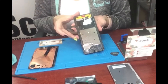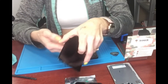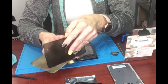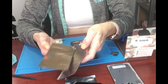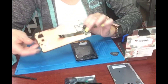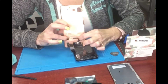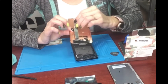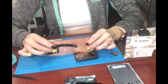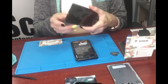So we're done taking off the screen, but something happened. When I was taking this off, the glass came off but this other part did not — and this is the part that plugs in, with sensors in between. So the glass came off, this stayed on, and I still had to take this off separately. If you're not familiar with that, you might not know what's happening. Right here there's a lot of glue, so you're going to have to add rubbing alcohol to make the glue melt and unstick it, or you'll have a hard time getting that off.